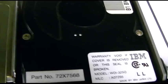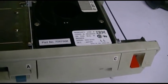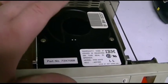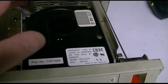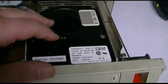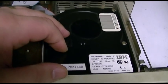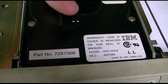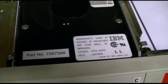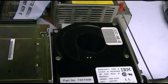The hard drive was made by IBM Japan. It had problems over the years and finally just gave up the ghost. I did try repairing it once and was successful. What would happen was the drive would make a re-synchronization sound, driving the heads back — it's a stepper motor drive. You were getting sector not found, general failures, and all kinds of stuff. I started hearing a scraping noise, so I opened the drive, and with the absolute slightest amount of force I took my pinky nail and bent the top head up just slightly. That was enough to cure it. Put it back together and it ran for another two years. But the drive was aged to begin with.